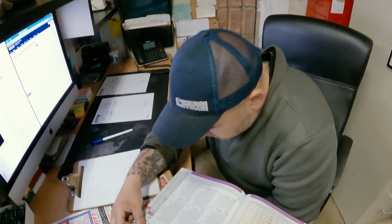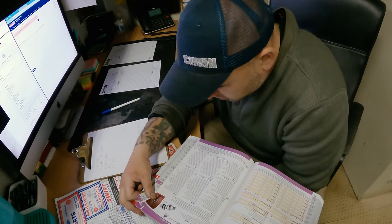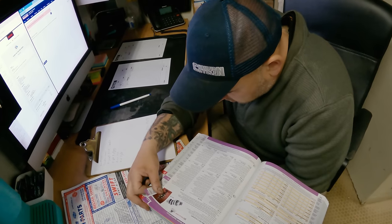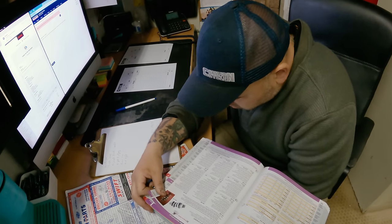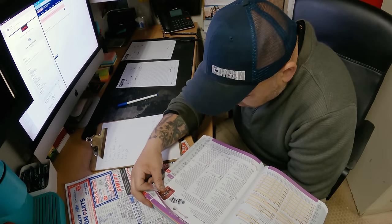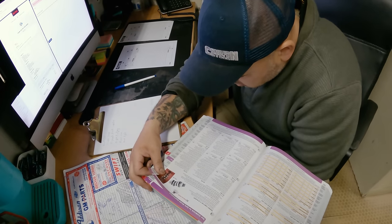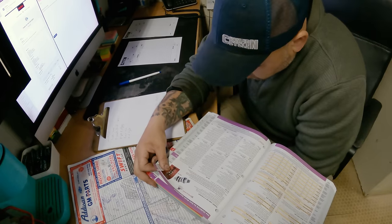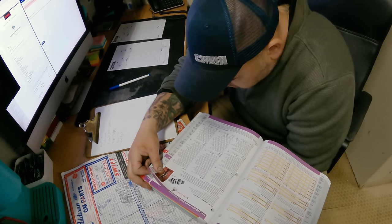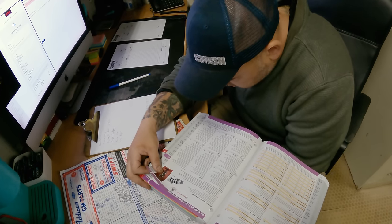The 538 cam: aggressive camshaft with a nasty sound, revs up fast and pulls hard in engines with big bore cylinders, modified cylinder heads, intake, compression, and exhaust. The Reaper 538 grind will shine in 124 and larger cubic inch engines. Ported cylinder heads are not required, but will complement the cam and add even more power throughout the range. The stock throttle body produces an excellent power band, and a high flow throttle body will increase peak power numbers. An exhaust and performance air filter are recommended. Feuling recommends matching this cam with their oiling system. High lift valve springs are required.